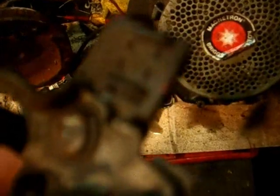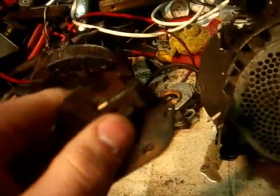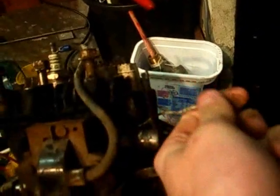Another problem is your kill wire, which is normally connected to a bracket that sits across the head like this. It has a little switch on it — that's the copper contact. When the throttle governor comes along, it contacts that splayed metal and grounds the magneto. If this system has a lot of dirt or wet moisture on it, it'll ground out there and on the splayed connector underneath. It can also ground out if this wire gets cut by the shroud.